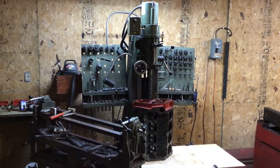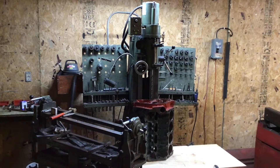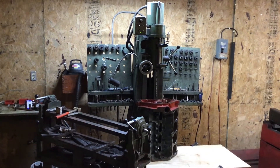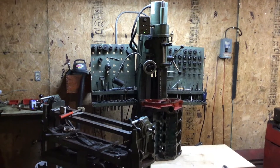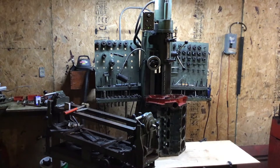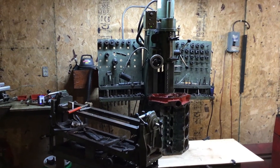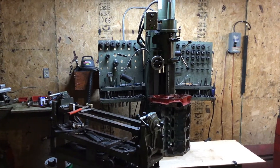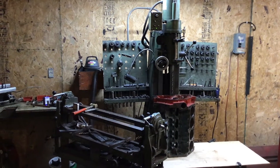I got the 340 block set up on a seat and guide machine with a 5/8 drill bit — a long aircraft-type bit. I set it on a piece of quarter-inch Luan plywood just in case the drill grabs and spins the block, so it won't scratch up my airflow table. Alright, let's get to drilling on this thing.